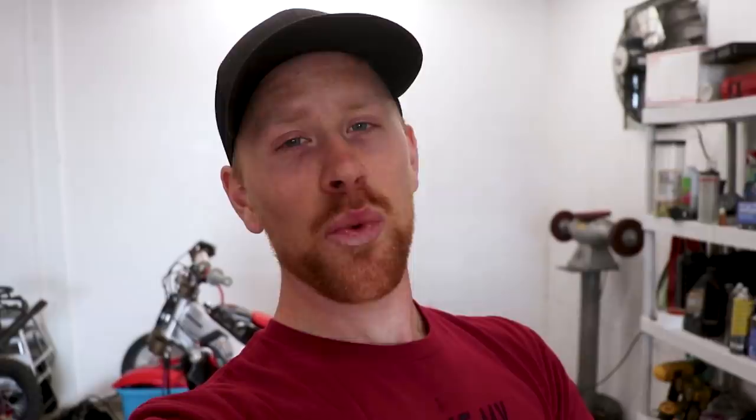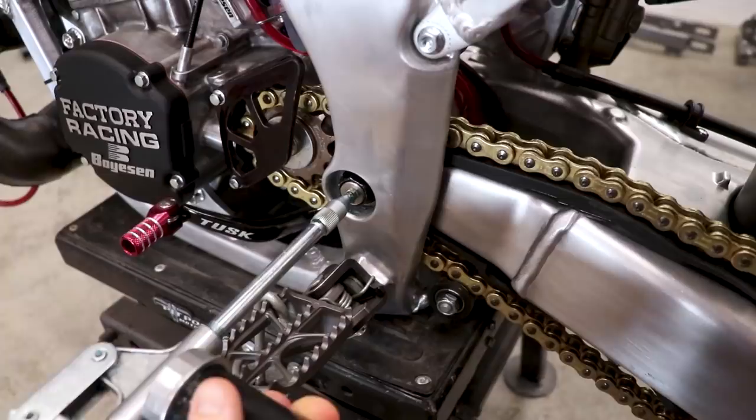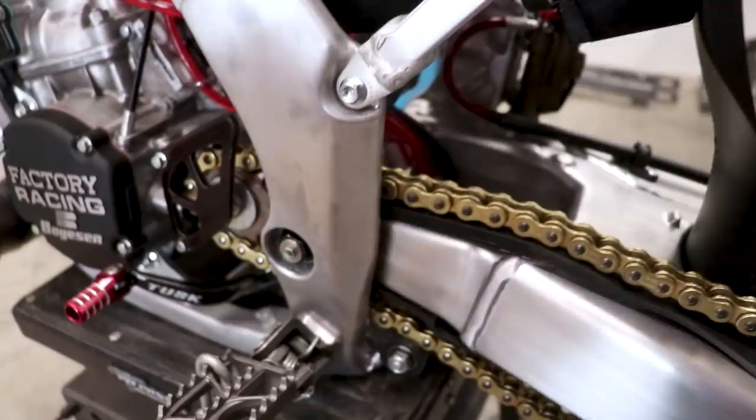Just a friendly reminder — I still have the Steel Horse giveaway going on, which ends this Sunday, September 15th. It's a swingarm bolt system that allows you to grease the swingarm pivot bearings without having to take anything apart on the bike. This setup replaces your swingarm pivot bolt and the bushings that go inside the swingarm, and it's got a grease fitting on both ends. Stick a grease gun on it, give it a couple pumps, and that's all it takes. I'll drop the link down below in the description. Thank you so much for joining me on this suspension build — I had a ton of fun and I'm really pumped on how everything turned out. Stay posted for the next video where we'll be bolting the suspension back on the bike. Until next time, keep it prime.